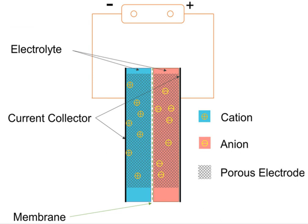Energy recovery. A primary challenge of all transport is reducing energy consumption and reducing CO2 emissions. Recovery of braking energy, recuperation or regeneration, helps with both. This requires components that can quickly store and release energy over long times with a high cycle rate. Supercapacitors fulfill these requirements and are therefore used in a lot of applications in all kinds of transportation.